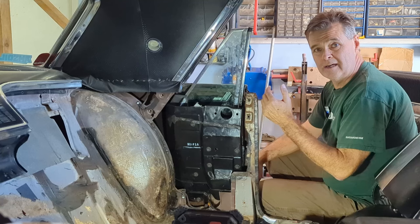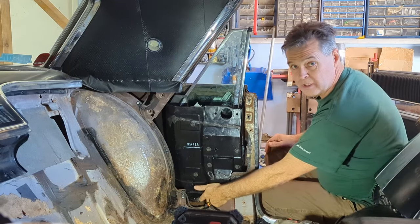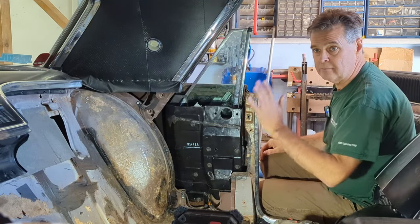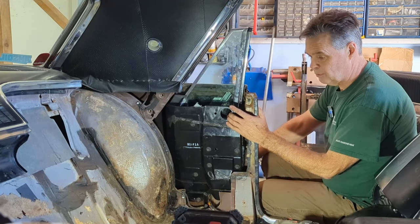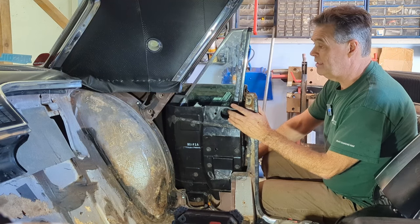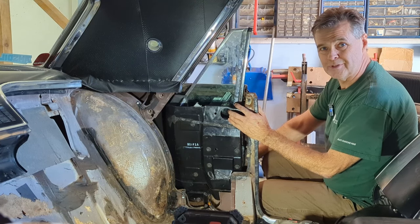That's it, everyone. Last tip for putting this quarter window back in: just leave the window up a little bit so you can clear that bump stop on the bottom. If you don't, you'll have trouble getting that bottom bolt in. No issue with the top bolt, but you'll need it up just a slight amount. Now I'm going to go on and do the other side — it's doing the exact same thing, so I'm assuming both sides will have been used just as much and probably just as dirty. But other than that, I didn't see any big issues in this window — the window is in good shape. Thanks a lot for watching everyone, and we'll see you in the next one.